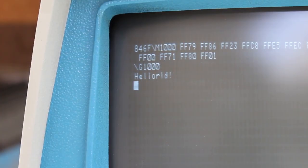Now comes the really difficult side, the software side. This laptop is running Microsoft Windows 10, and the Centurion is, well, it doesn't even have an operating system on it. The closest that we have is a test operating system, or TOS, and really, it's not an operating system as such, it's more a memory monitor. Pretty much just allows us to peek and poke bits of memory, but we can also jump to a bit of memory and execute some custom code from there.